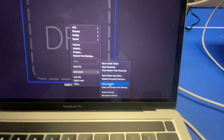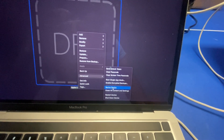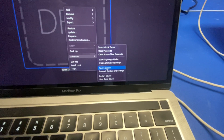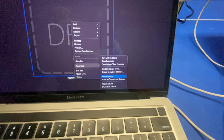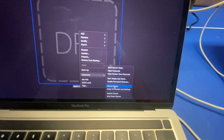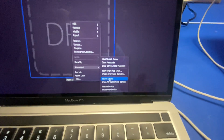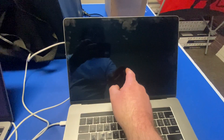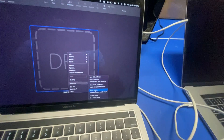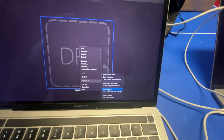If you hit Revive Device, it's just like hitting Revive Device with your phone plugged into your Mac — it'll revive it. It won't hurt your data. What it's doing is rewriting the firmware to the logic board. I haven't had massive success with Revive Device — maybe a 30 to 40% survival rate with that. You'd hit Revive Device and you'll see the Apple logo and loading bar come up, they'll match each other, and it'll finish. It takes 10 to 20 minutes.